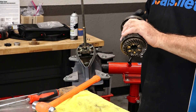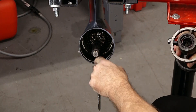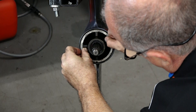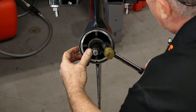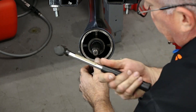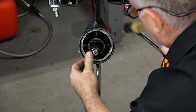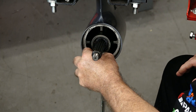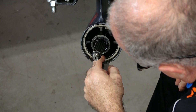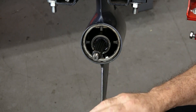What we're going to do now is pack some grease in between these two seals and then put a light coat on the o-ring just so it's easier to assemble. When we're doing this, remember to keep this little keyway down at the bottom so we don't have to rotate it quite as much. It takes a little bit of persuasion to get the o-ring to seat in there, but do use a soft blow hammer so you don't scar up the splines on your output shaft. Rotate it around and let's get our little square pin in place — she's in. Now our lock washer: make sure both threads are cleaned up and put a little bit of grease on the threads as you're installing it.